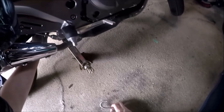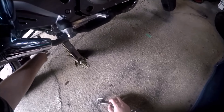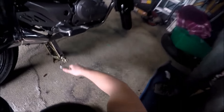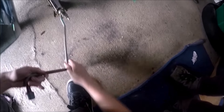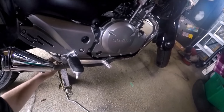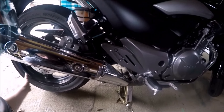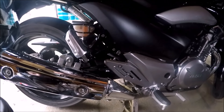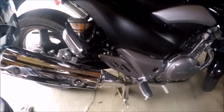I could put it further back, but the suspension arm on this doesn't have the bottom of the suspension coming down here — whereas on the Kawasaki we have that, and that's where we'll jack it on that bike. This is the Inazuma 250. The jack is just going to hold it centred so it's off the ground — you don't need it that far off, just a little bit. And you want to spin the wheel that way when you're lubing it.